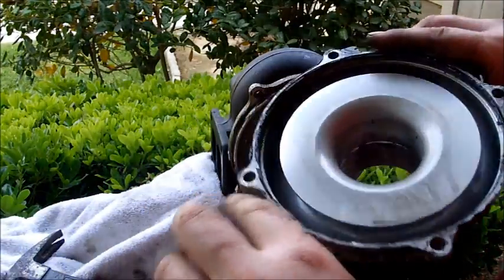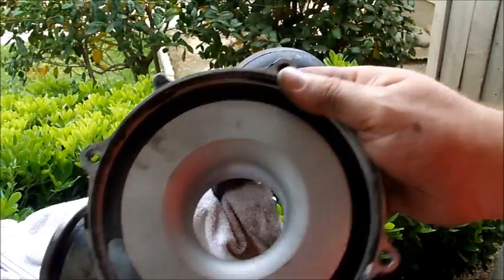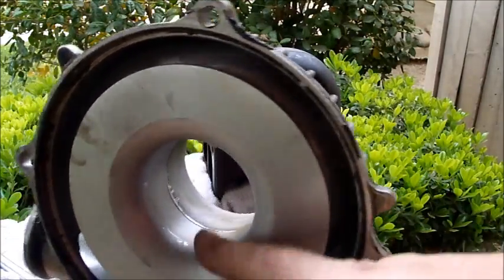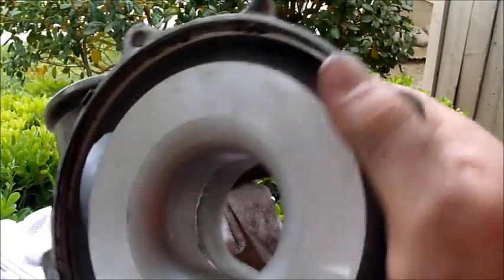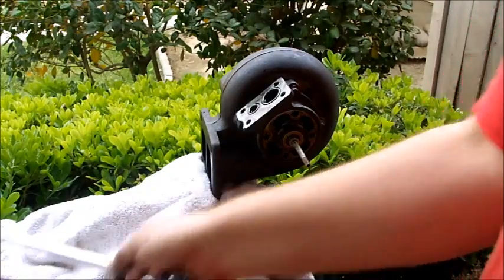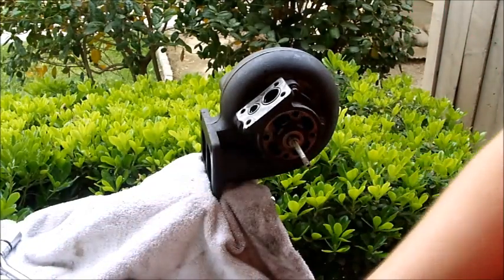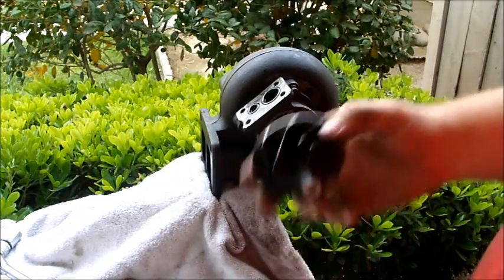I had to use a little gentle persuasion because mine was all gunked up. I've already dug into the turbo a little bit — I went ahead and pulled the outer housing and inspected it for wear. It's nice and smooth. It does have a couple spots where it looks a little scuffed; something might have gotten in there while operating and got pinched between the turbine and the turbo. But all in all, this housing is fine. I used an 18mm on the back and a 5/8-inch deep socket on the front to pull this wheel off the shaft.